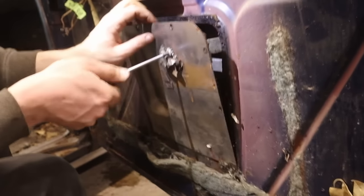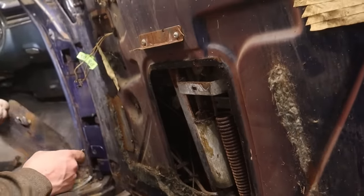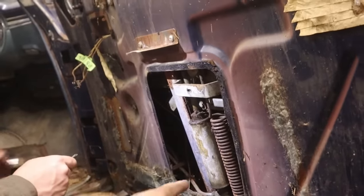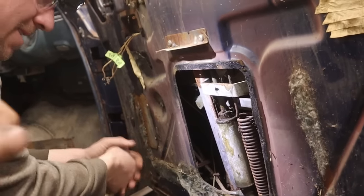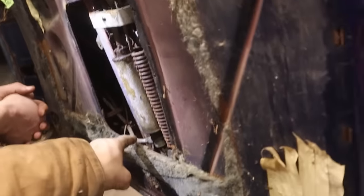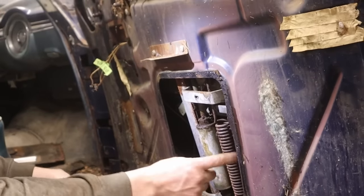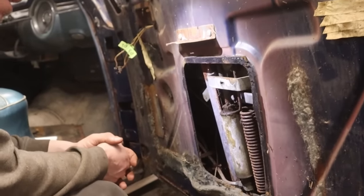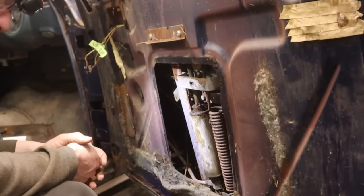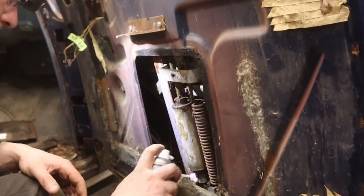Cool. Look at that, hey? So the thing is that the spring is always pulling it down and the pump is one way. When you push down, all you're doing is opening the valve at the bottom of the cylinder and the spring pulls it down. Yeah, exactly. Because look at that spring. That's like a clutch spring. Well, no wonder they end up with all the windows down out in the bush. Because it's impossible for that whole system to be so tight that that spring doesn't always win.